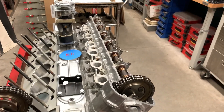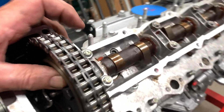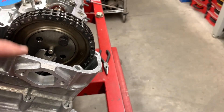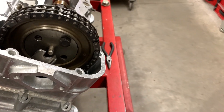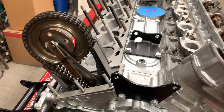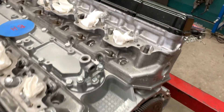As you can see, we got the B-side cylinder head down tight against the short block. What I've done is taken the time to get the timing sprocket on the hub on the camshaft and pull the chain tight. I got everything lined up and got one bolt in finger tight so the timing chain, sprockets, and hubs aren't just flopping around on the front of the engine. Now it's just a matter of doing the same thing on the A-side — piece of cake.